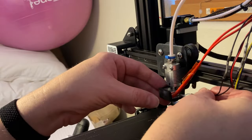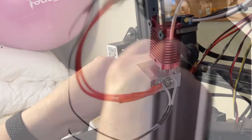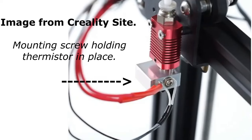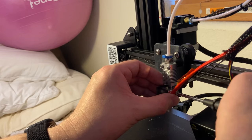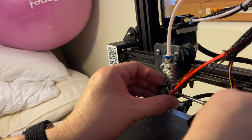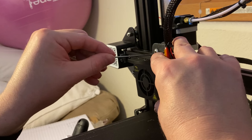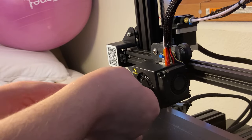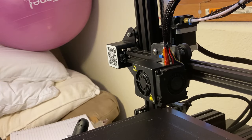Once they are spliced, just reverse the process and slip the thermistor back into the bottom hole and use the screw to secure it to the mount. Don't over-tighten the screw here as it can twist or break off the thermistor and you'd have to redo the entire process. Then just slide the fans back over to cover the heating element, reattach the two allen head screws, check for any loose wires, and give it a test.